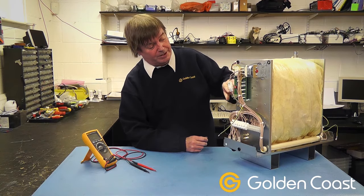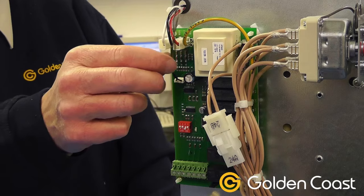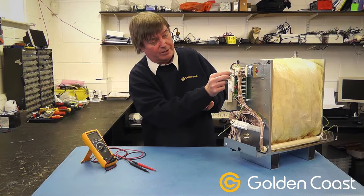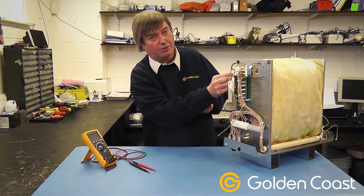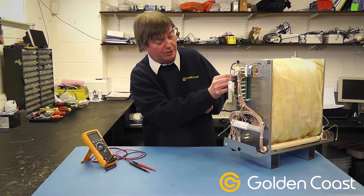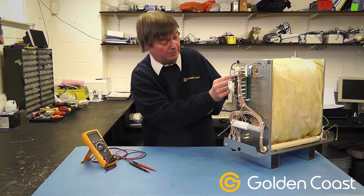Then the control PCB. You don't really get many problems with this one except sometimes this little overheat sensor on the circuit card. This one gets pushed in with the thermostat. And sometimes if these wires short out internally it will keep the inlet solenoid open full all the time, and you'll get water coming out the steam head. The best thing to try is to just pull it off and disconnect it and see if that closes the solenoid. And if it does you know straight away that that's the problem.